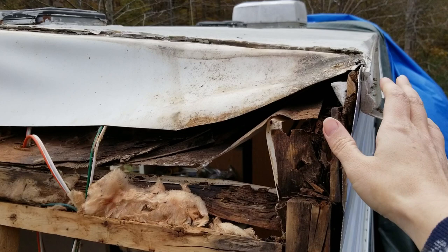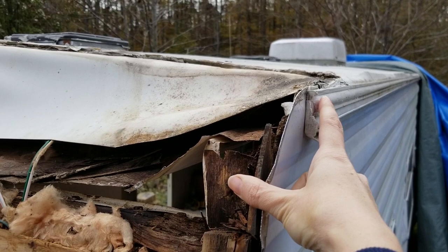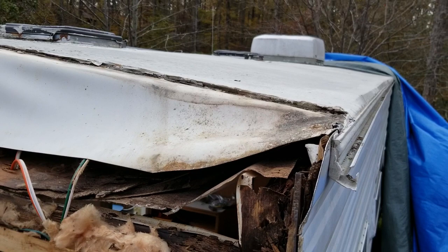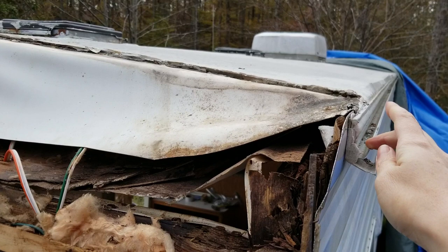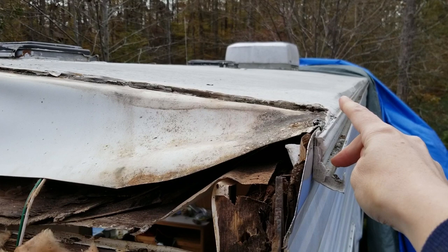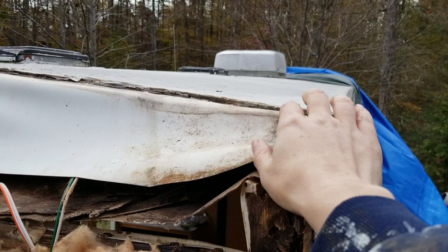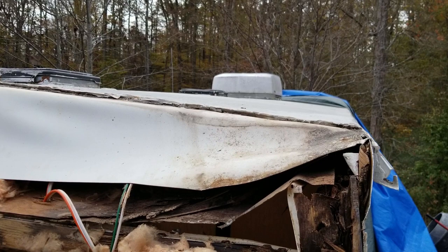So I'm up on the roof now. You can see this gutter system here, and there's a little strip of trim right here — this trim actually pops out, and there are screws hidden underneath of it. Those screws and this trim are what's holding the roof down the whole length of the trailer. So we have to take those screws out and pull this trim out just far enough. You can kind of see where the ridge breaks down from the rotting. We're going to go all the way back just a little bit farther than the rotted part and pull this rubber roof up just enough without having to take the entire trim down or pull the whole roof cover off.